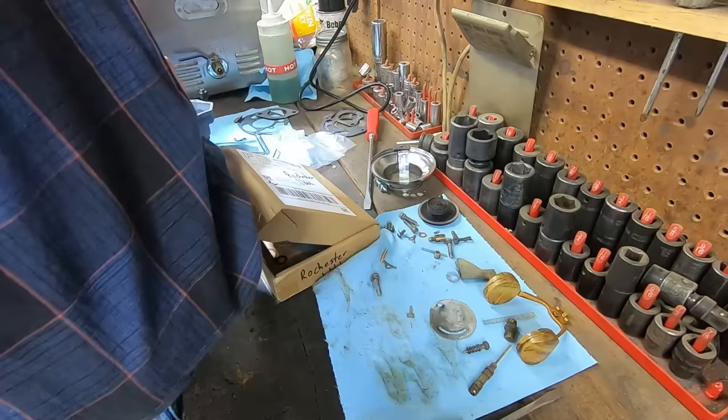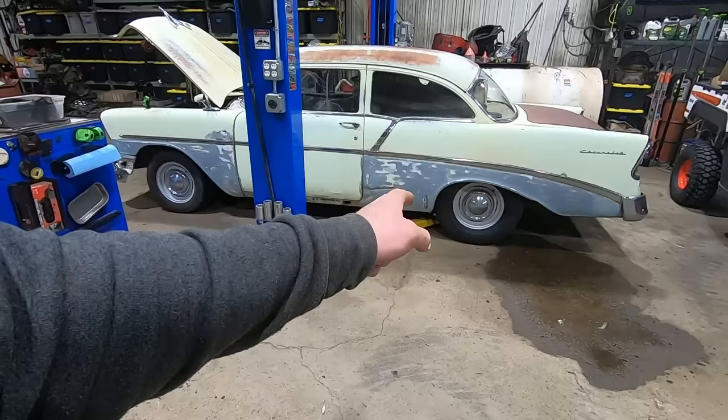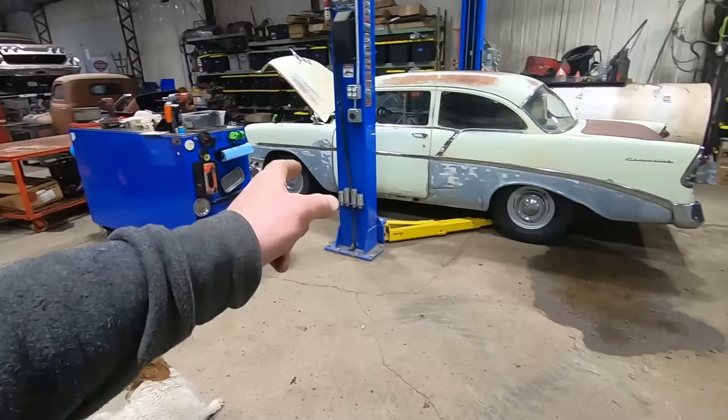Doing a little playing around with this thing last night. We had 205/70s all the way around. I went to the tried and true 235/75 pickup tire, put that on the back, and it looks way more gooder. I think it's a 28.8 inch tall tire, and those 205s are 26.2.